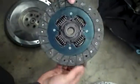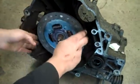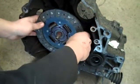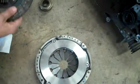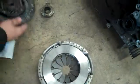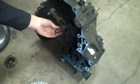This is what we call a clutch plate. It goes on here and it's splined to the shaft of the transmission. So when it's spinning, the transmission is spinning at the same speed. This clutch plate goes between the flywheel and the clutch pressure plate, and when these two are pushed together, it will squeeze this together, making this spin and thus making the transmission spin.